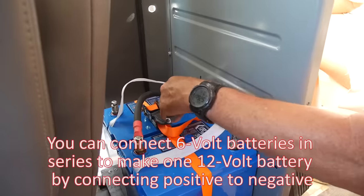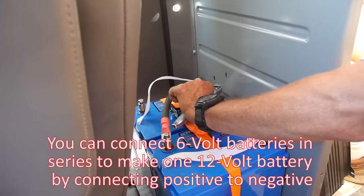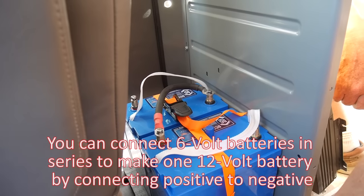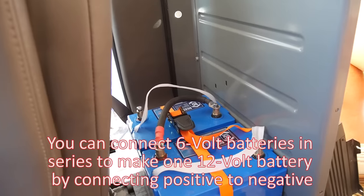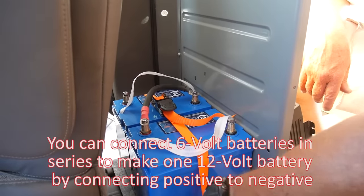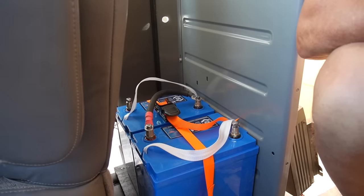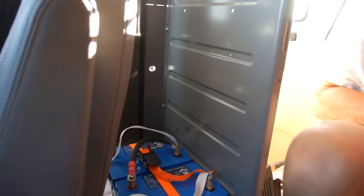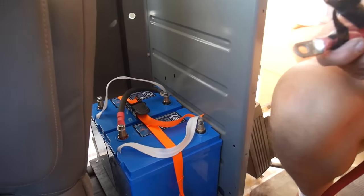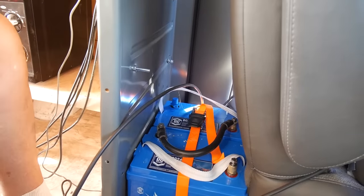We're making these two 6-volt batteries into 12 volts — a very simple process. The positive post of one battery connects to the negative post of the other battery. Those two connected posts are still 6 volts, but the other two posts are now 12 volts, and that's what you use from now on. So now those two 6-volt golf cart batteries are 12 volts. Just this one simple heavy cable. We're using 2-0 everywhere, and one 4-0 which I got real cheap. So now we have two 12-volt batteries, one behind each seat.